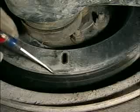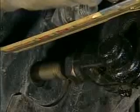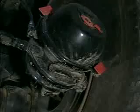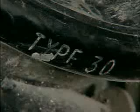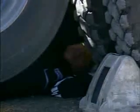Place a screwdriver into or on the brake shoe and yell, "Brake." Feel for movement and measure the travel distance of the plunger out of the brake chamber. This is usually a Type 30 chamber and is allowed 2 1/4 inches maximum, and travel should not exceed 2 inches. Do a test for each side. Brake. Release. The adjustment's good. Cotter pin's in.